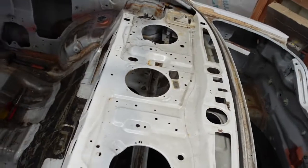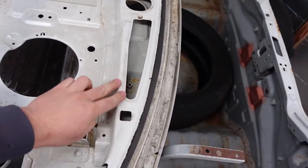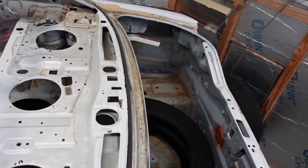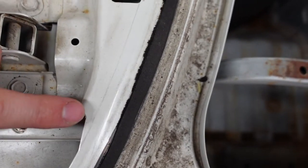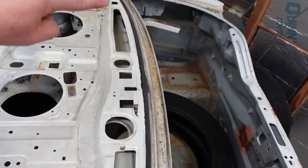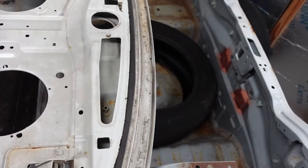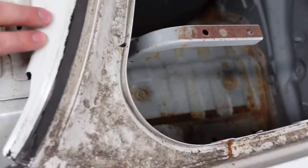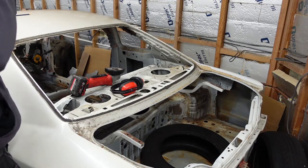So, with drilling the spot welds of this out, this section here, as you can see it going across, will still be retained, which I don't need. So, you might be able to see it's very faint with a pencil line. I've very roughly sketched a nice sweep all the way around, trying to follow the curvature of the window, or the bottom where the window seal would be. So come over 10-15 mil from that, so we should be good. Wish me luck.